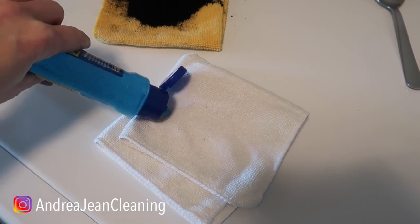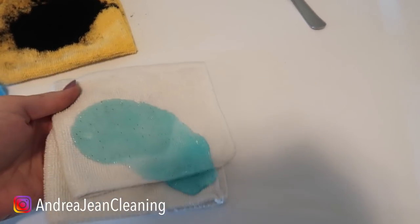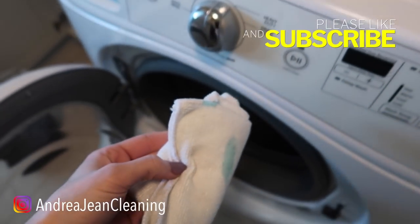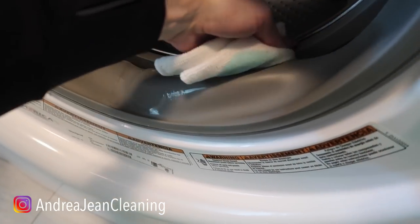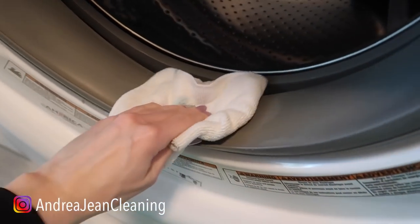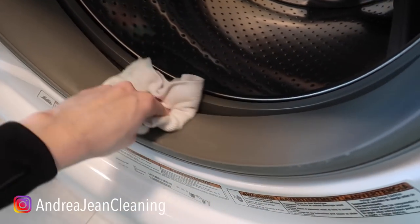You're going to put a little on a microfiber towel — you could use a paper towel. It's a little bit gooey. The first thing you want to do is clean out the inside of your rubber seals. I should have gloves on, so don't model what I'm doing right here. Be generous with the amount that you use — it has a nice fresh smell to it. Get in there, clean all around and inside the drum. This works for a top loader as well as a front loader like you see here.